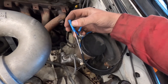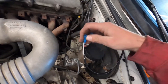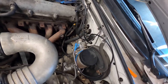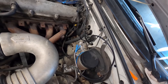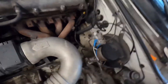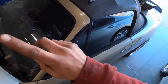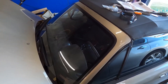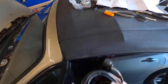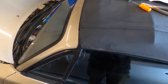I've got the white wire from the AEM going to the blue wire, which should be the signal input on the old harness. I'll clean all this up, trim everything and shorten it down — I just wanted to make sure it works and give myself enough room to mess around. All I have left to do is put the O2 sensor in and run the wire next to the transmission, up through the inner shift boot, and into the tombstone behind the gauge.